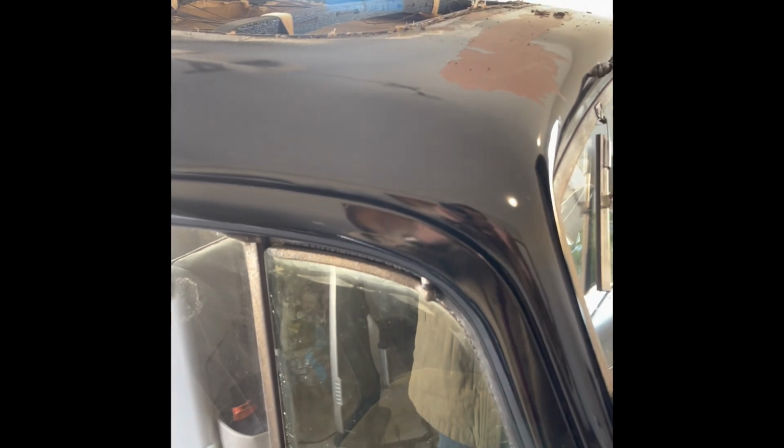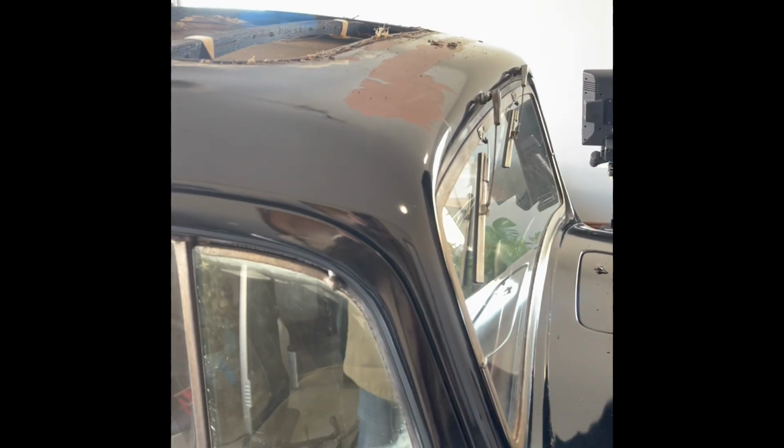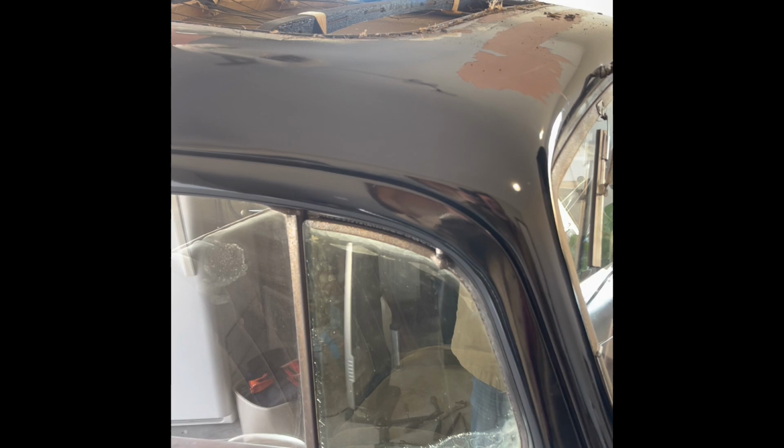Oh, speaking of which, before we go, I was talking to a friend of ours that does a lot of installs, old vehicles, all kinds of stuff. Back then they used a type of sealant. It used a hand pump, right? You kind of poured it into this channel and it self-leveled itself. It's called Dolphinite. I don't even think the company exists anymore. Some other new company, I think, exists for that name, but it's not the same stuff. But he told me of a replacement, and he actually ordered it for me. It comes in little cans, and a pump screws on top, and you pump it by hand, and of course it's liquid and it fills in and it solidifies.